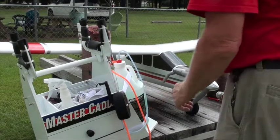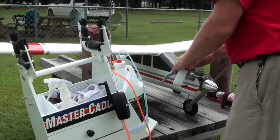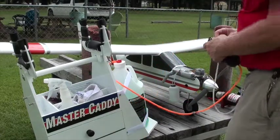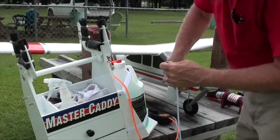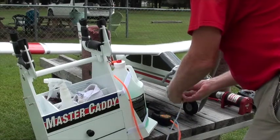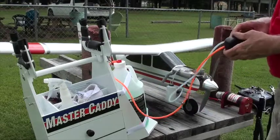Okay, it's time to fuel the airplane. First thing I'm gonna do is put on the overflow tank. Next thing to do is take the pump off, pull out the tube, pull out the fuel filling tube, pull out the green fuel line — that's the third line for the tank.